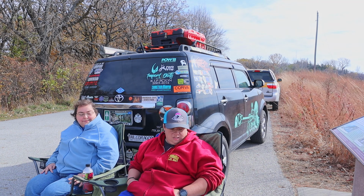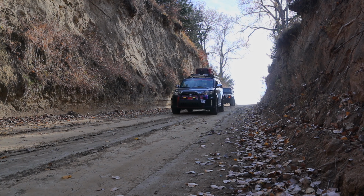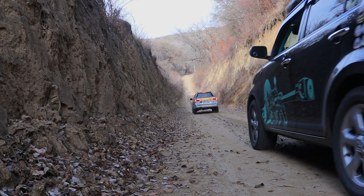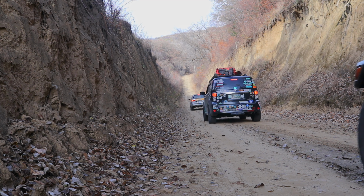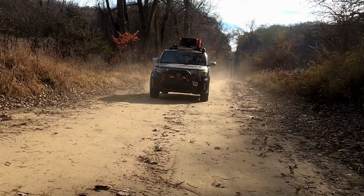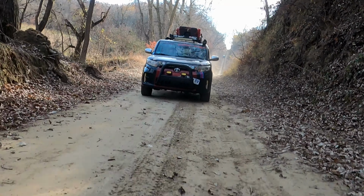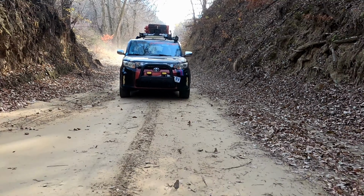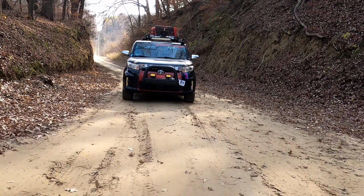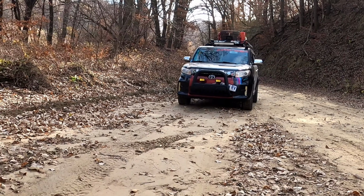The front suspension and brakes are from a third gen RAV4. Everything bolts right up. The struts are longer than the XB ones, and the brakes are bigger than the XB ones. So both of those are obviously a performance upgrade. The rear has metal 2-inch spacers under the rear springs to pick the rear up, because the RAV4 struts are basically a 2-inch lift in the front. So it's 2 inches all the way around. And then the tires and wheels give it another inch or so of lift. So it's got about a 3.5-inch lift right now.